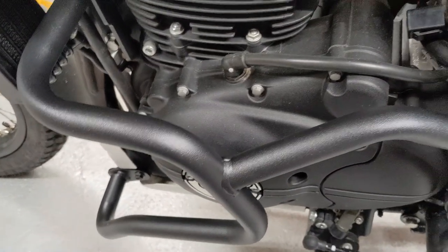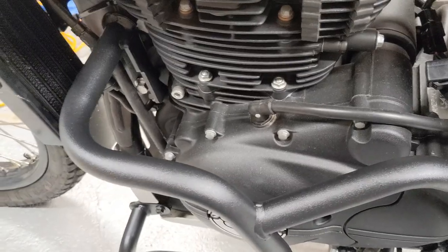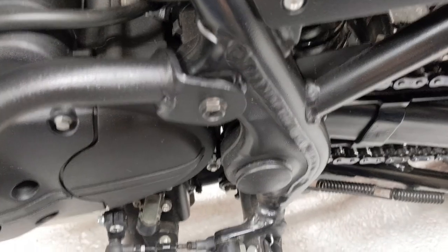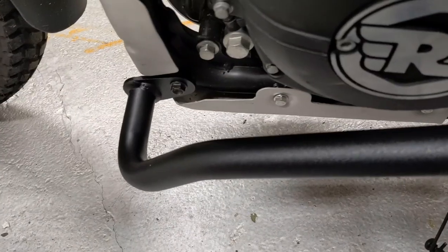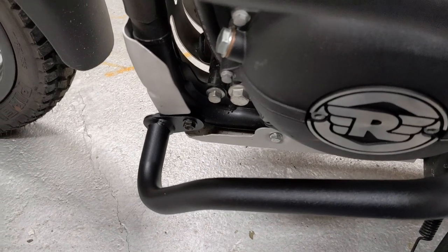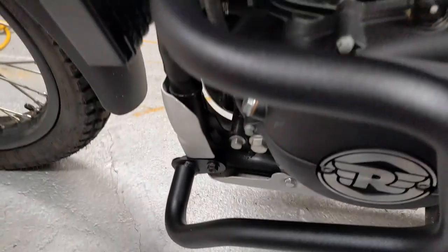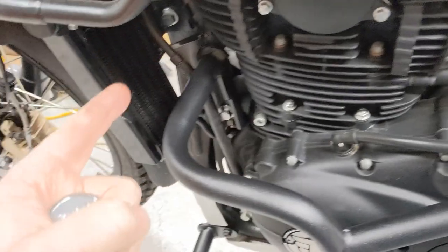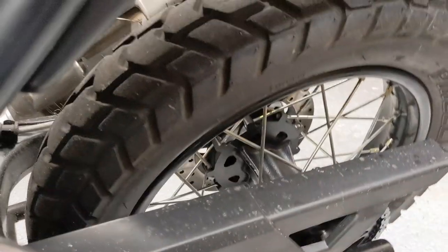Additional advice: it's a good motorcycle, but let's be realistic — it's not made of titanium. If you push on any of these bolts, specifically these, you will just rip the threads right out of it. Be gentle when tightening them, but don't go crazy. Things to remember: if you loosen the exhaust — the two 12mm bolts that hold the exhaust and the bracket in the back — make sure you put it all back.